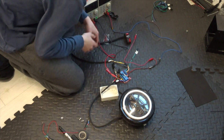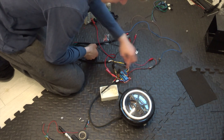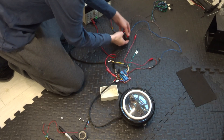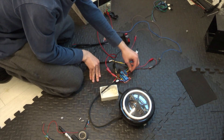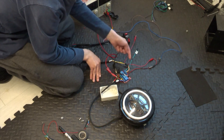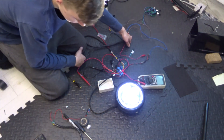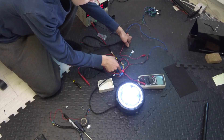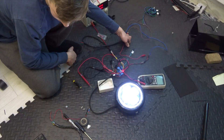Here I have it all laid out on the floor - it's a bit of a mess but it's just a demonstration. I've got my power supply here supplying 5 volts for the control and 12 volts for the main power. I've got the switch here with the high and low beam settings going into the relay: one wire goes to 5 volts, the low beam wire goes to one relay and the high beam wire to the other. Trying low beam - interesting, even though it only fires the high beam relay, the light does both. Low beam, high beam.